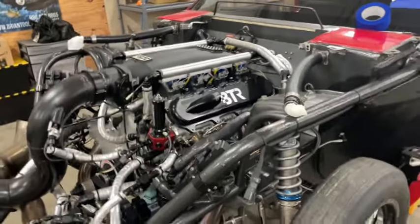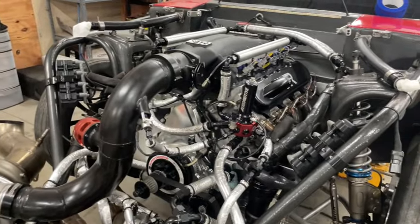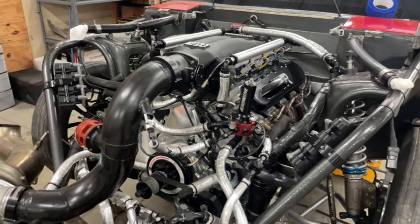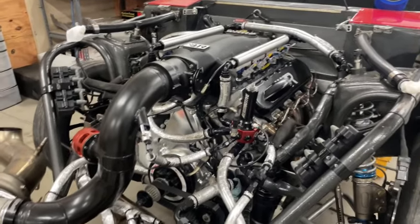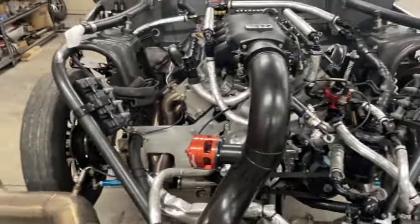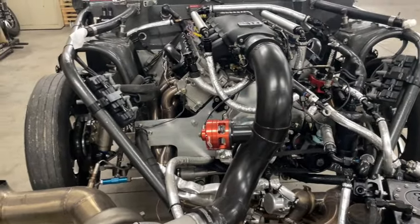Time to make a little bit of progress on this thing. We're closed this week, got the shop cleaned up pretty good. I've got some stuff to do the next two days but I got a few hours today, and I don't want to start a project I can't finish - I want to start a different project while I'm thinking about something else. So let me get this thing torn apart. I'm going to get the injectors out, get them soaking in WD-40, get this engine out. I want to poke around and go over things. I think I'm going to try some different stuff with the push rods, like some restricted push rods, because the drain back kind of sucks. Like I mentioned, I need to change the rear gear and get the transmission out, but just got to do one thing at a time.